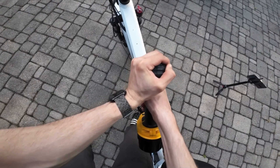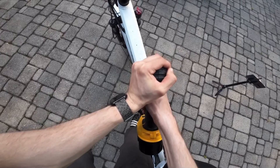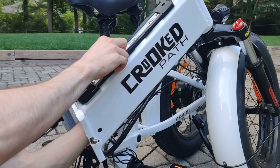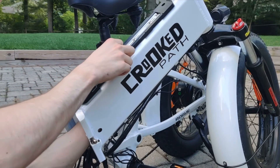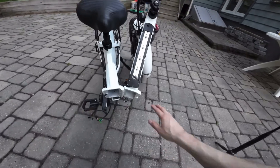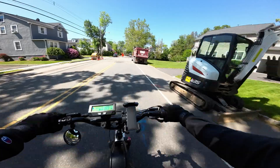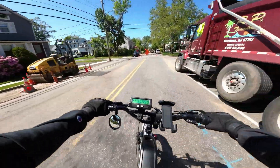The hollow frame is a perfect place to stash the controller and extra wires, helping keep the aesthetics very clean and professional-looking. The frame also allows us to easily mount the new battery on top. Fair warning: the battery is going to be a tight fit, but it does work as long as you put the base plate as low as possible on the frame, close to the hinge.